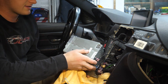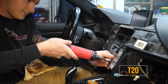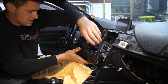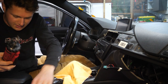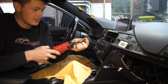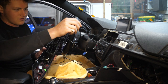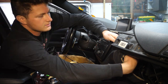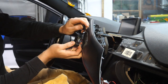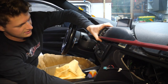With our new harness installed, we can now reinstall the head unit. Tuck all the wires back and reinstall the four T20 Torx screws. We can now install the control panel — just one connection on the right side — plug that back in and install the four T20 Torx screws. We'll also reinstall the two screws that hold in the display, plug back in the illumination light, reinstall the trim piece, and run the antenna cable down through the dash to our MMI. Plug the lock back in and also plug in the hazard — pull the hazard wire through the dash piece, plug it in, and reinsert the button assembly. Pull the remaining antenna slack through and reinstall the dash trim.